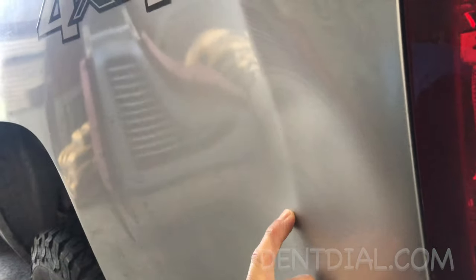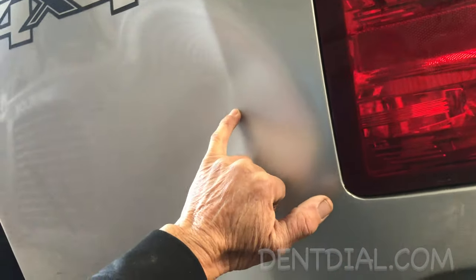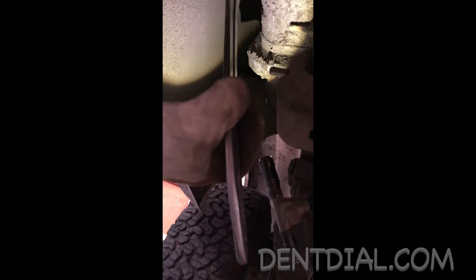I'm going to start here with this first push because I want to release that body line, and then while it's out, sit on my butt, look this way, and hit that crown. I'm glad I've got my glasses on — this dirt's falling out of this. Alright, it's a good spot. Now I just have to sit on my butt and pull.